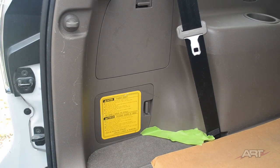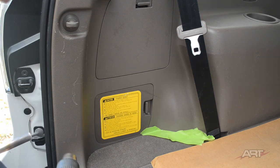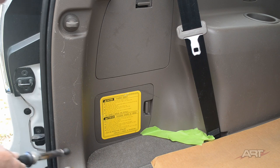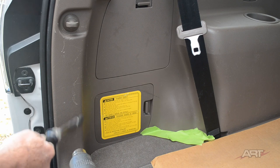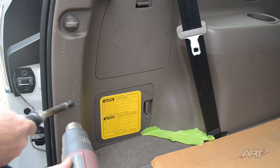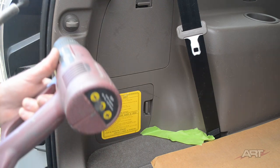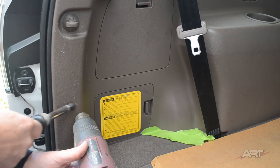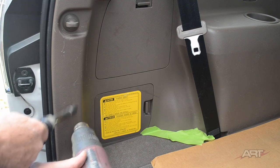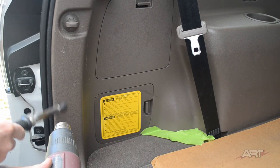For the deeper scratches, you may see me pulling plastic into the scratch, simply because with polypropylene, very seldom is there actually plastic missing. If you've made a gouge in the plastic, then the plastic is still there, but it's in a high spot. You've just plowed a furrow. And so you can pull from the high spots and replace the plastic back to its original location.